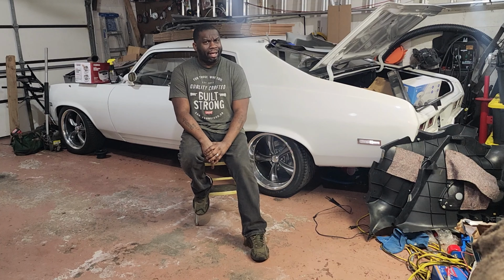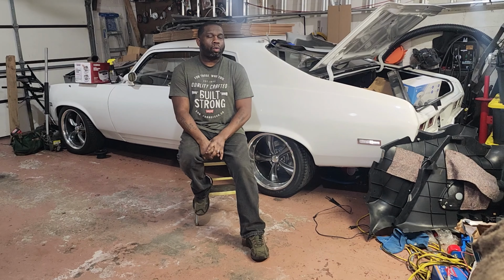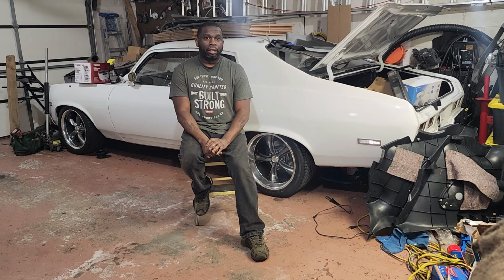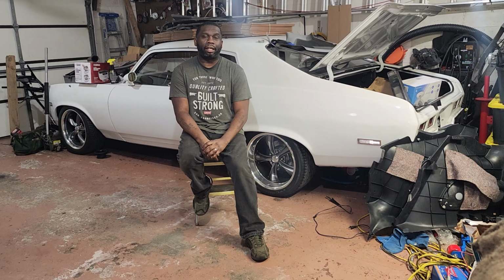The next con isn't really a con, but some people shy away from it. It requires a little bit of wiring. It isn't as bad as it seems. It's pretty much just depinning the stock 60E harness, because the harnesses are interchangeable, repinning a few pins and plugging it right into the 80E.